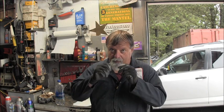Remember what I said about the spark. They will run on that spark that you can test with one of those adjustables. You only need a little over a 16th of an inch and it'll spark. And if you put it on a standard, quarter inch gap OMC type spark checker, you won't see the spark. At least that's what I found with them, and I've done dozens of them. It was through trial and error and a lot of patience that I learned it did that. So I'm passing it on so that you don't shoot your Suzuki.